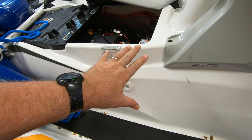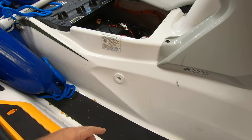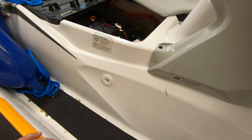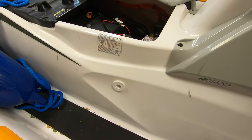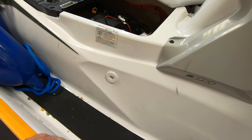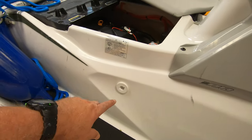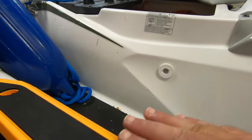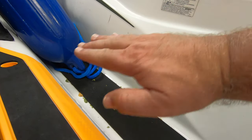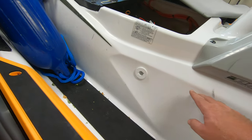The reason I put it here is that when I ride, if I started having trouble with the carbon seal or leakage coming in, I needed basically immediate notification that I was having problems — aside from my boat sinking. The idea is to have the water being discharged from the discharge port hit my leg and fill the wheel well. One of the problems here is that this discharge port is below the level of the gunnel.